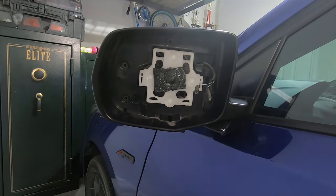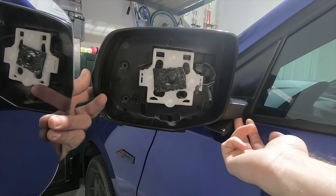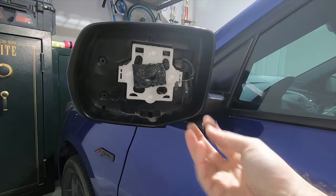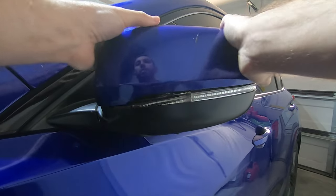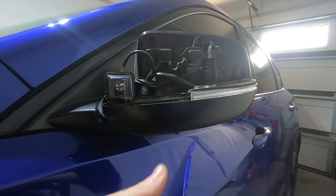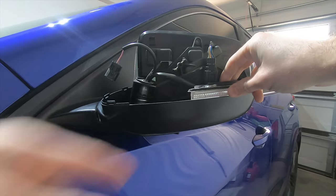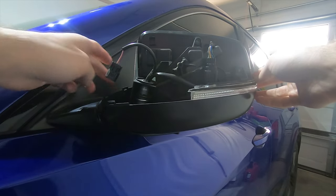Now there's one more screw on the housing right under here, so you have to rotate it just enough to feel the screw. With all the screws removed, gently pull on the plastic cap, removing it from the car. There's the broken reflector — unplug it from right here. The other reflector is hooked around the pin on the bottom bracket, so I need to separate these two front and back plates. With that screw taken out, that should be fairly easy.